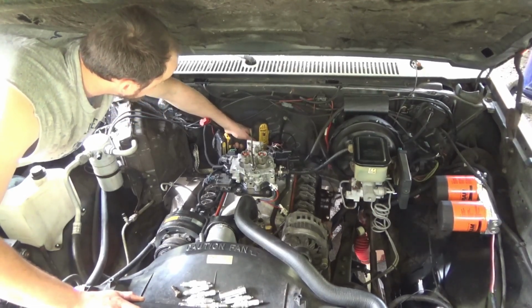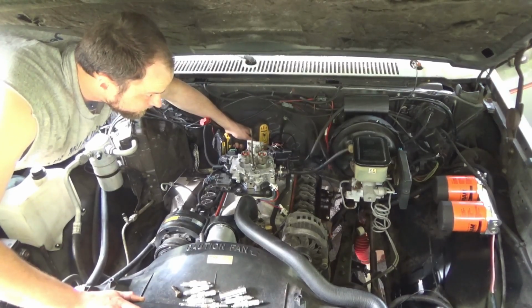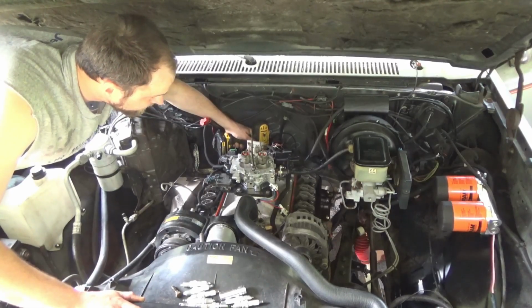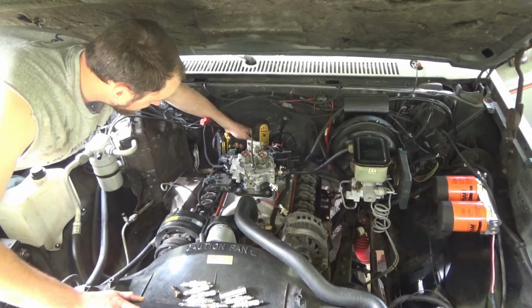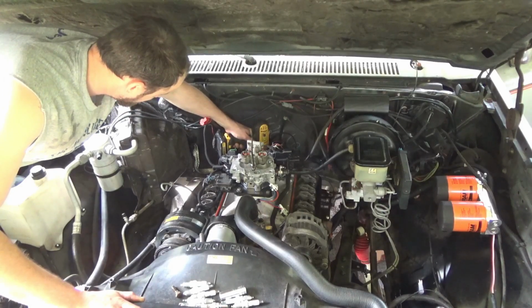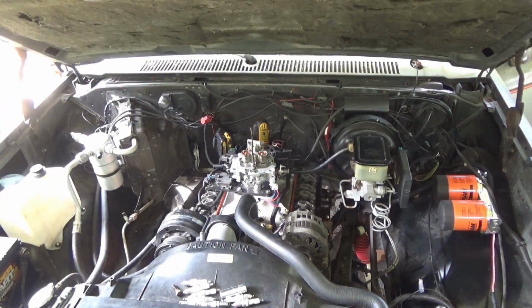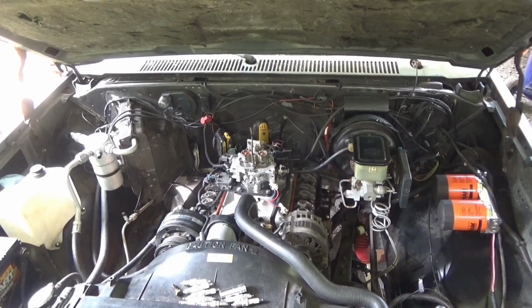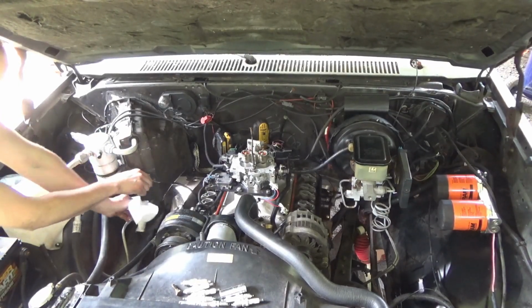Pressure on the gauge? Uh-oh. Is there pressure on the gauge? What the hell? We are gurgling and doing all sorts of stuff. I wonder if we sucked the oil pan dry. Shouldn't have. Five in it? Yeah, it should be 6 with the filters here, but a quart low shouldn't be making that much of a difference.